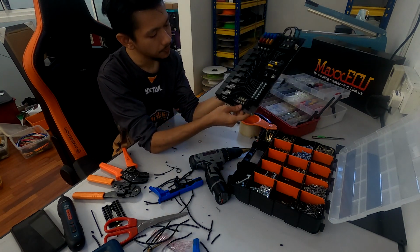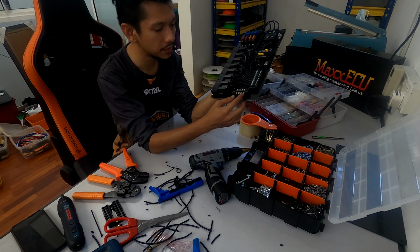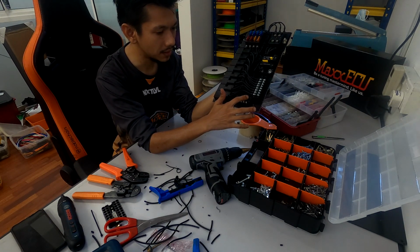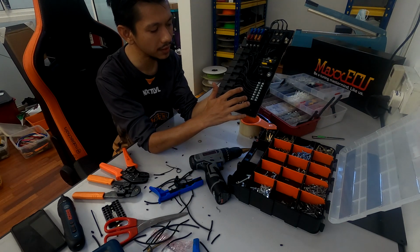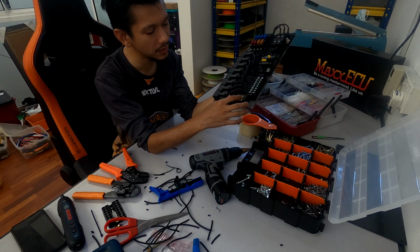So this one, the switch. I'll have 4 switches, right? One switch is to activate basically the front fans, the radiator and the condenser fan. Both will be run together. This is ground, so it doesn't really matter though. You can wire like 2-3 wires at the same time, as long as the ground is adequate, it should be fine.